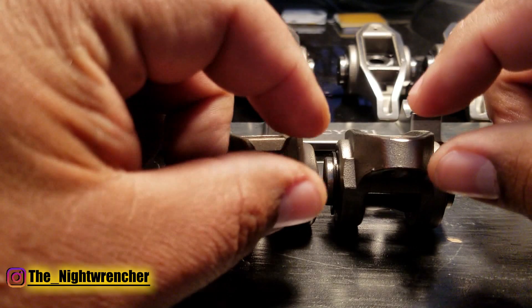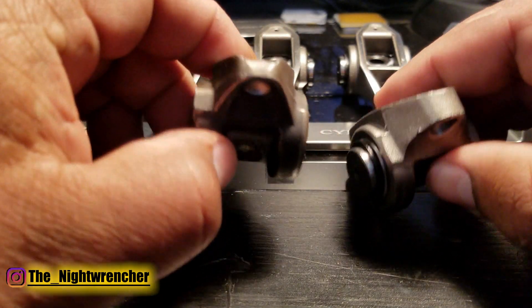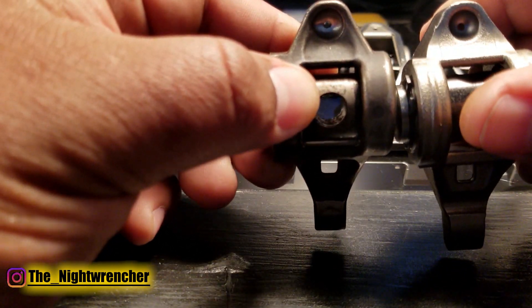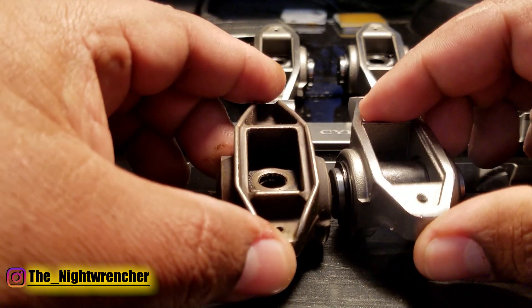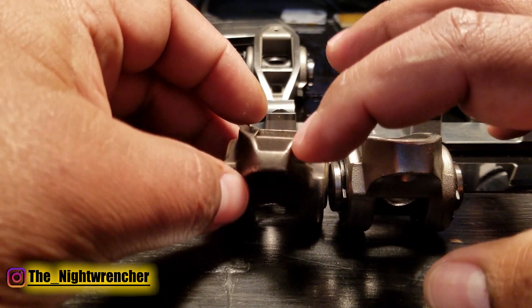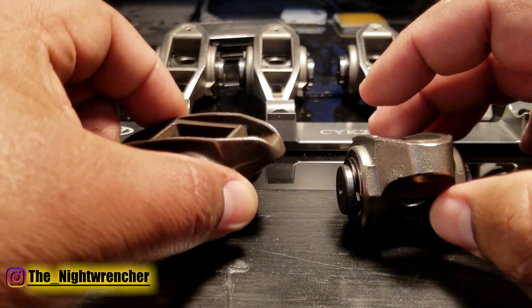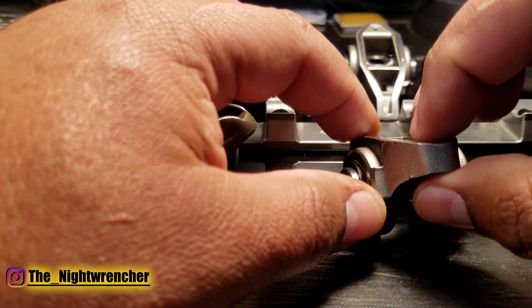If you move over to the back, you can see that the push rod area has also been upgraded. This is a much thicker casting. The pocket for the push rod remains almost identical, but the area on top where the oil gets spit out of is a lot thicker. I've known that once stock rockers get a little worn, the push rod will tend to push through that casting and break the rocker. You basically eliminate that from happening when you go with the thicker casting.